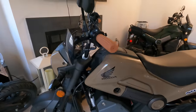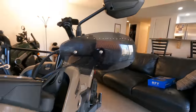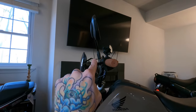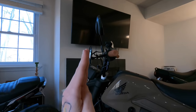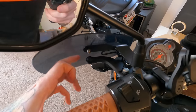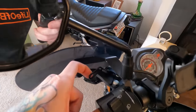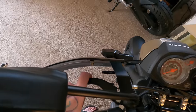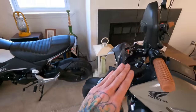The hand guards are on, but that was a lot trickier than I thought. The hand controls on the Navi bars are actually uneven — so even though I bent the brackets the same way, the hand guards aren't in the same position. I started with the left side and had to bend it up a decent amount to get it to actually cover the grip and also avoid the parking brake. You still have clearance for the bolt and plenty of room for your finger to activate the parking brake — it took some bending and finagling, but that side was easy enough.